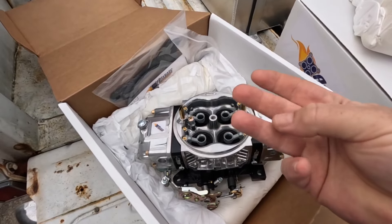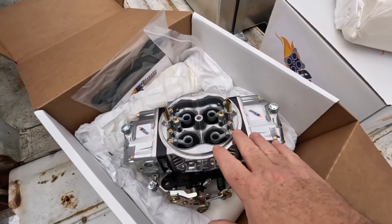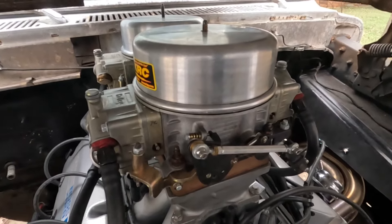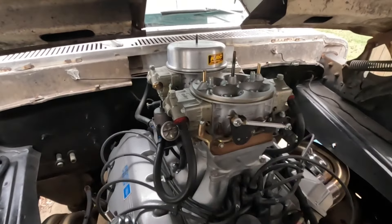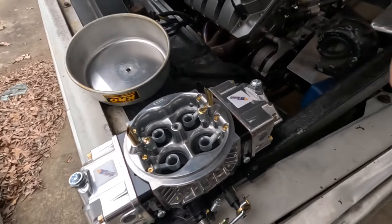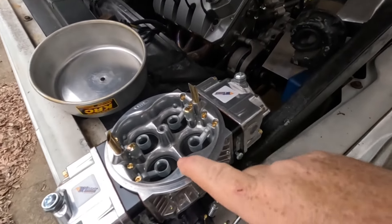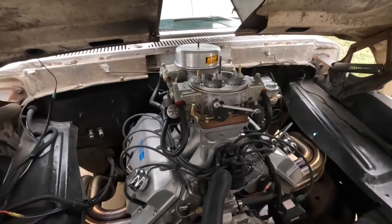What we're going to do is basically a three-way comparison between these carburetors and the dominators. Mind you, this is a 750 double pumper and this is a 750 dominator. So we're going to find out if CFM is the same between a dominator and a 4150 — something I have never seen or heard anyone talk about. The comparison is going to go like this: I'm going to find out how streetable the new carbs are out of the box, put it on the chassis dyno, dyno it with the dominators, baseline it, and find out how much power Casper's making at the tires with those carburetors. Then we're going to swap these carburetors on at the dyno, and the final test will be how do they accelerate at the drag strip.